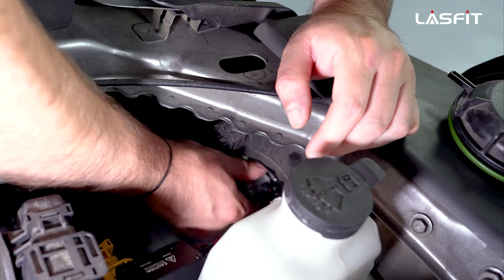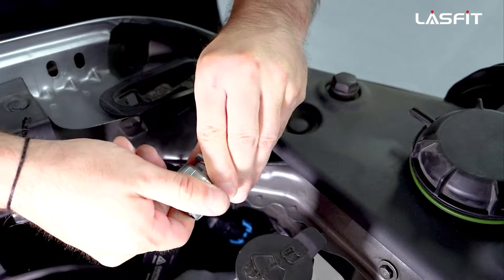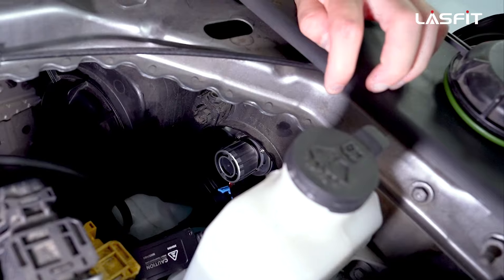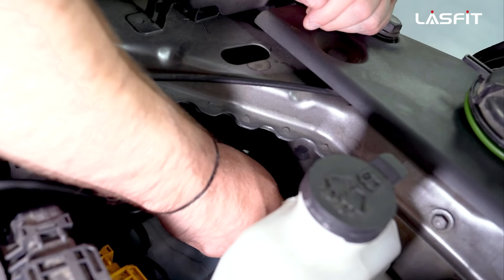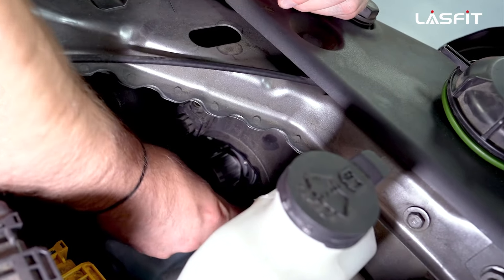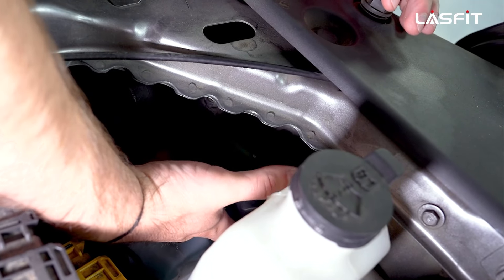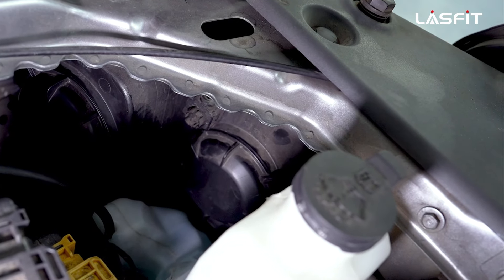This bulb didn't lock in at first — since it is adjustable, turn clockwise and make sure you're aligned. Reposition it back in. You have to make sure all three tabs are aligned and pushed in — now it's fully engaged and the clips are all inside. Grip the driver and find any slot you can, which always tends to be on the bottom. Just bring it in and tuck everything inside so when you put the dust cover on it doesn't interfere. Everything's tucked in. Simply put the cover back on — the top piece always tends to go on top. Simple install — you'll be done within five minutes or less.